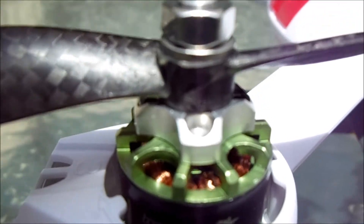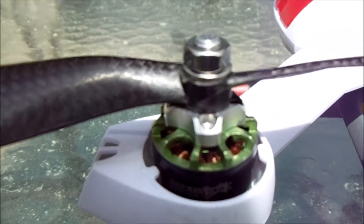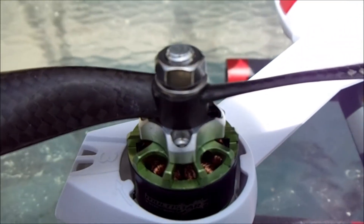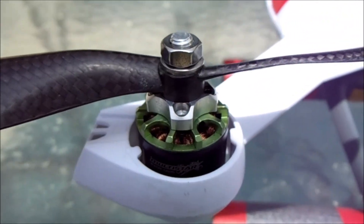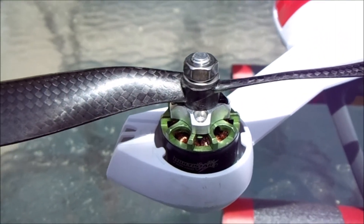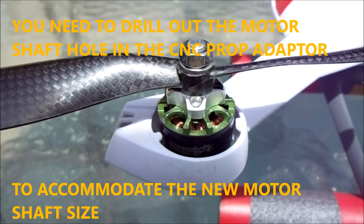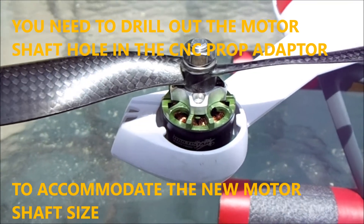You can see I have modified the small parts CNC prop adapters so they'll fit this motor. Now they will not fit this motor as it comes, so you'll have to do some modification to the CNC adapters if you want to use those. I don't use the stock propellers and I have no intention of doing that. The stock propellers for the 350QX will bolt up to these Multistar motors. However, I wanted to maintain the utilization of my CNC prop adapters, and I like the idea of being able to bolt various props on without too much trouble — and these prop adapters are fantastic.